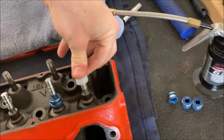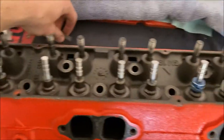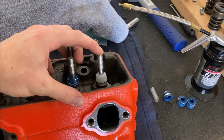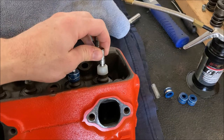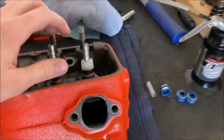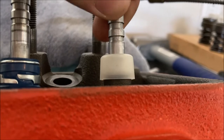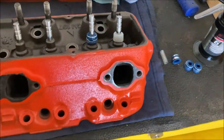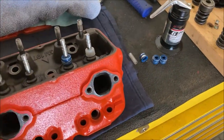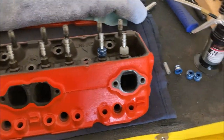Got it sat down on the bench. I push it down all the way. So my umbrella seal was seated all the way down, and then as soon as it pushes down the first time — see, that valve goes down but then it comes back up and pulls the seal with it. That's what this umbrella type seal does. It works honestly pretty good; you're still not getting up to the top of that valve stem seat unless you look real hard.